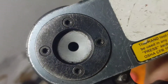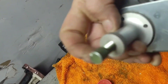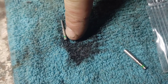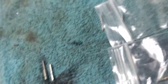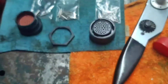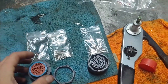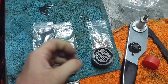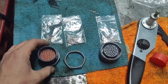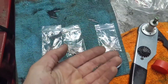These are the crimpers you use. It just crimps all four sides at once. These are not cheap — I borrow them from work. But they're adjustable; you adjust the height which changes how deep it's going to crimp on the pin, and the other adjustment changes where it pinches. Different ones will sit at different heights. They sell a weather pack style that's cheaper, but those are the ones where it bends over the wire and they always distort a little bit. When you have this many wires going through here, it's a pain to get them in and seated properly. From my experience with them, they're not worth messing with. This is the way to go — you crimp these and they stay straight.